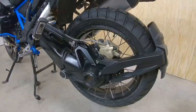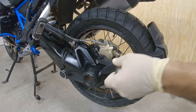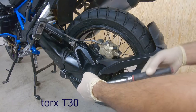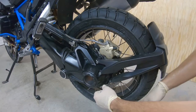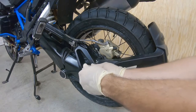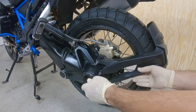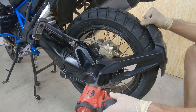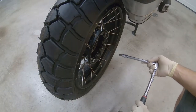So stay tuned. Alright, the first step is to take out the rear fender using the Torx number 30, and then the Torx number 50.